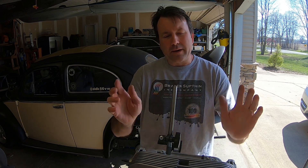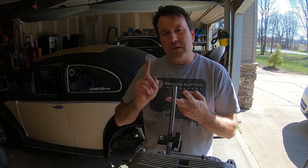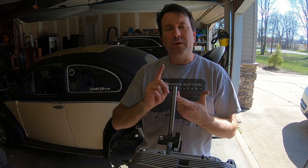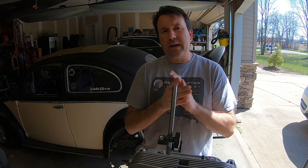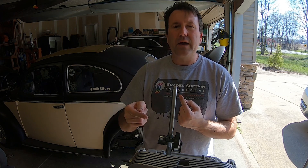I did tell them what I wanted in these heads. Basically it was going to be a 92-millimeter bore, but yet they were cut for 94-millimeter cylinders. I needed to clarify that with the combustion chamber, and I told them I'm going to be running roughly 600 thousandths lift. So there's a few things I got to check on here, and I'm going to show you one of them — that is the retainer to valve guide clearance.